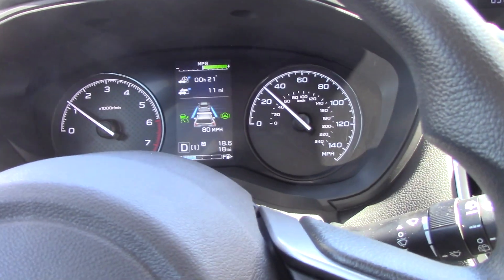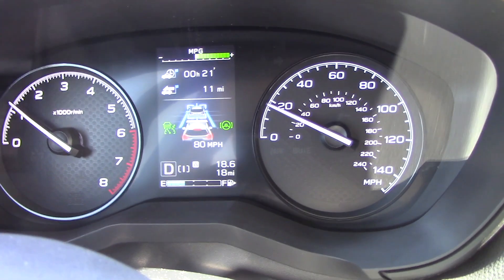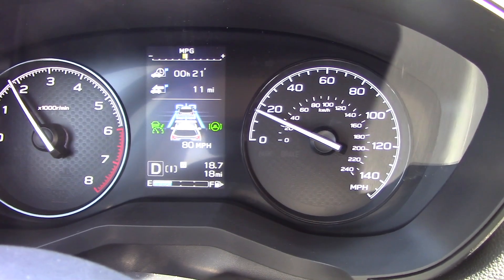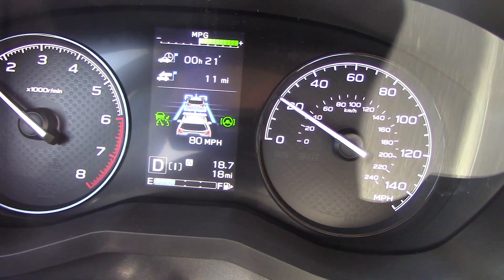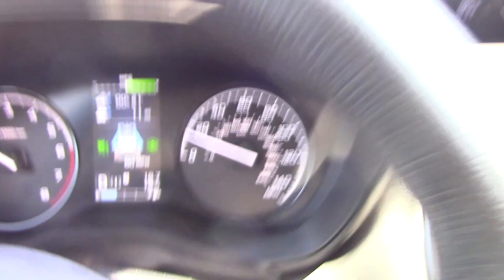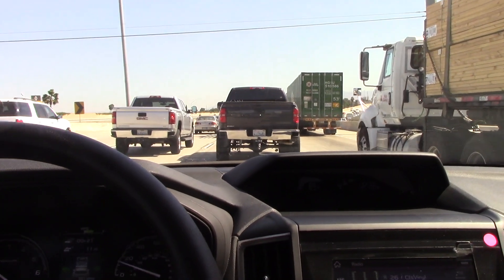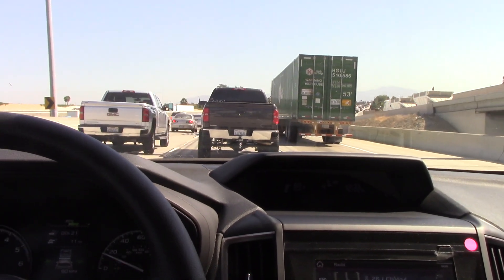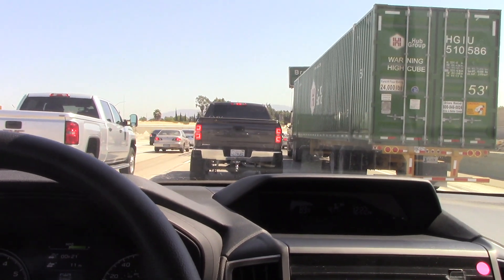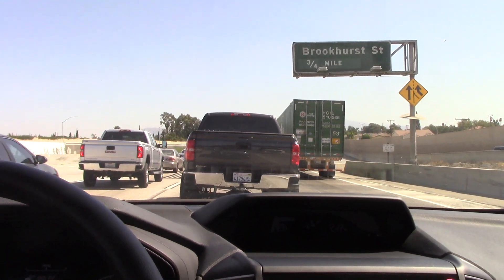Just make sure you pay attention to it if you're using it. Make sure it's engaged — if that little steering wheel turns white, that means it's on but it's not active because it can't read the lines. Those little blue lines on either side of your car: if one of those goes away, it means it's not reading the lines on that side. In theory, at that point it'll just follow the car in front of you if you're locked on. This system does definitely seem to work, but it is conservative — it'll turn itself off if it's not confident in what it's doing. So just pay attention to that.